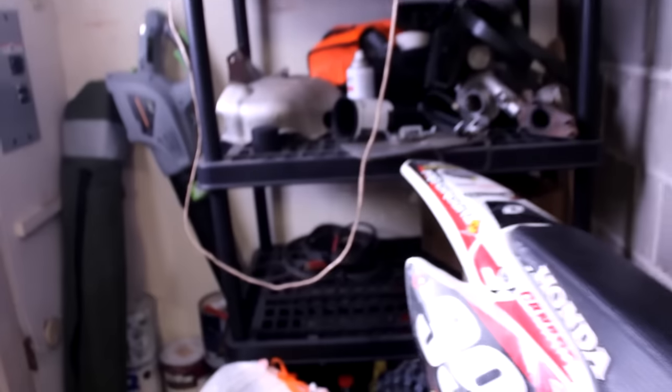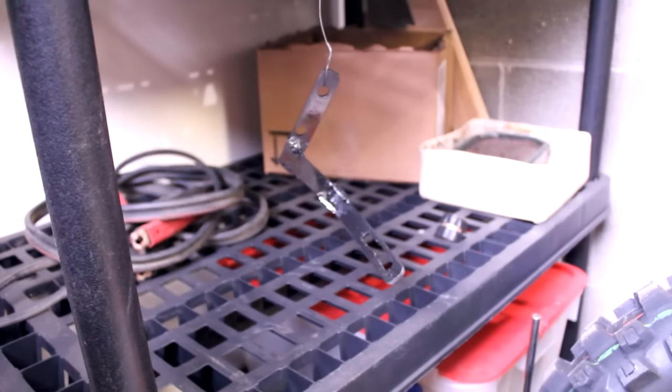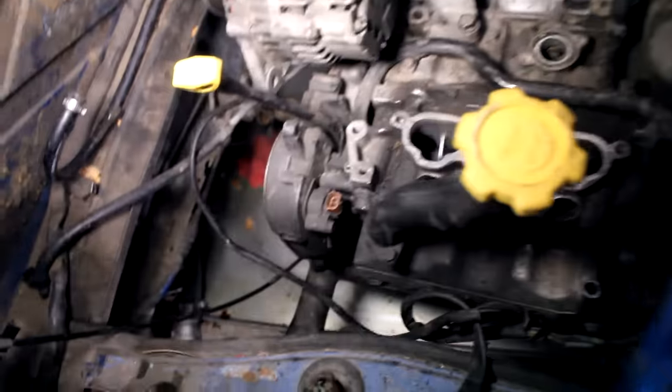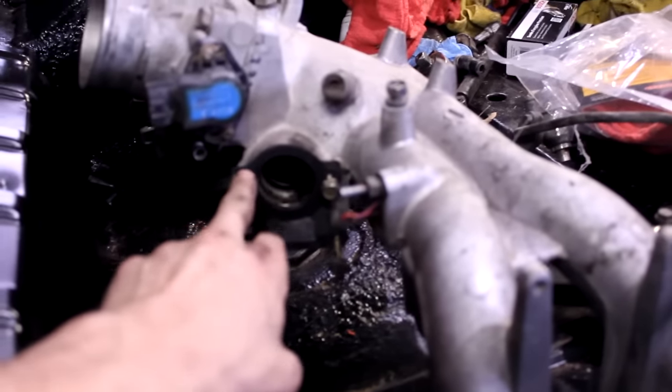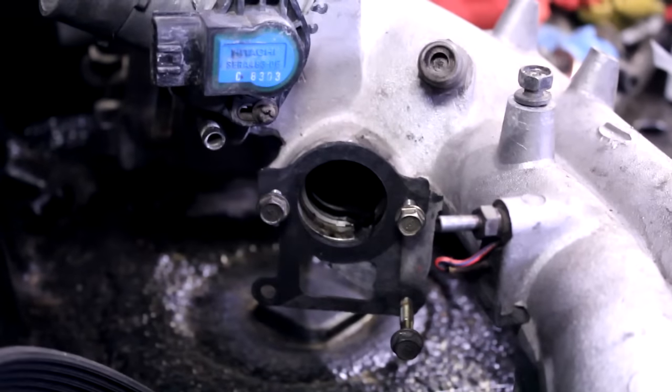In the last clip I was telling you how I needed to make an alternator bracket for this intake manifold flip. Since then, I've fabbed up this little piece — that's going to be the second bracket piece — and mounted on there it seems to be nice and solid. The two holes will just fit into these two holes right there, and it has a slider so it's actually adjustable as well, like the factory one was. My next step before I can put this manifold back on is to create a block-off plate for the IACV hole in the manifold, since it goes straight into the intake manifold. I'll just create that out of sheet aluminum.